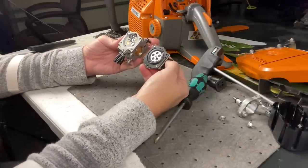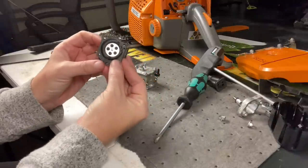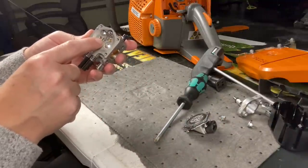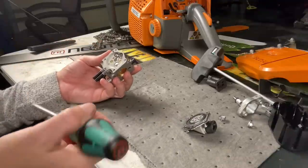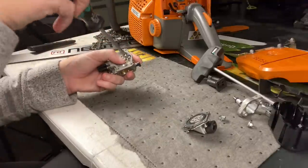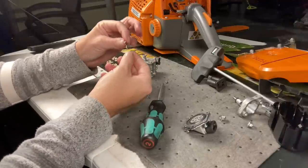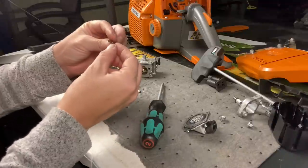No way — I have immediately found what's wrong with it. Other than the fact that this diaphragm — look at how off-center that is. This circle here should be in the center, not cocked off to the side. But look at this: this is the needle lever, and someone put it in upside down. There is no movement to that whatsoever. Somebody on the assembly line wasn't doing their job that day. Let's take this thing out. The spring's still in there — oh, this thing was crunched down the wrong way. It was in there with this little nipple part poking up, and that nipple part is actually supposed to go down into the spring.